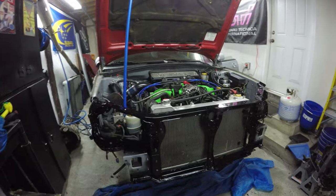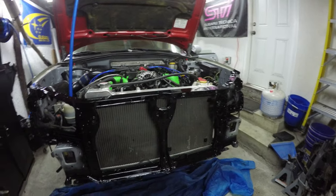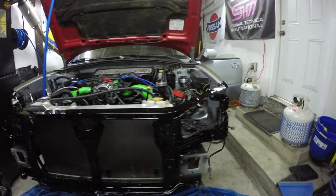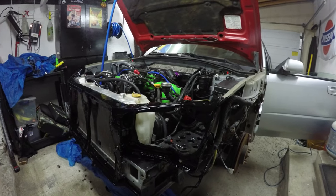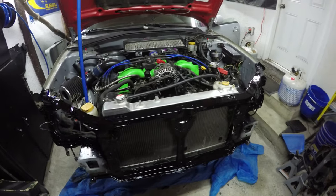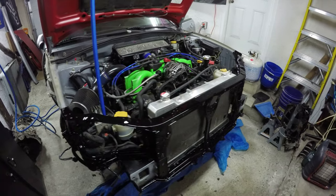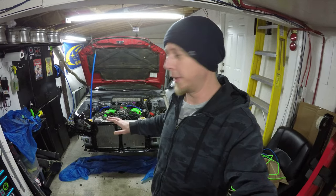And here it is the following morning, something like two hours after I've sprayed the second coat of black — laid on there really nice. It's gonna be a lot of corrosion protection and of course the color change from red. It's obvious that it's been changed out but it won't stick out so bad when you pop the hood. Now that I have the header panel and the rad support all welded on, painted and finished, everything else is literally bolt-on — just preparation work of whatever I'm gonna do with the fenders, the bumper, and the headlights.